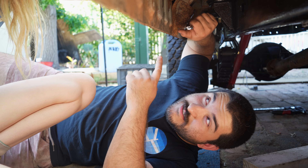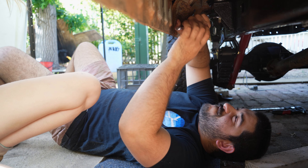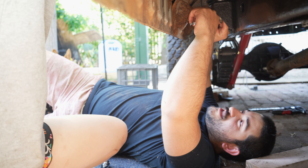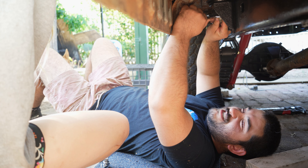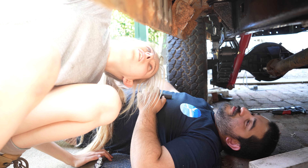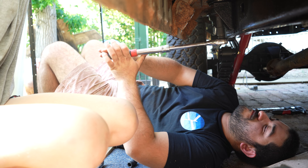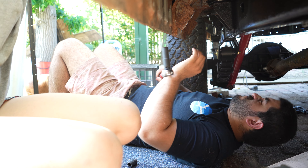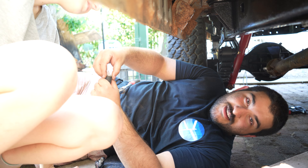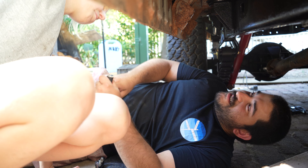When your ratchet eventually falls off the top, get some help. That's a super tight one — it's actually undoing the nut. What the hell is that angle — is this bolt bent? Looks like the bolt's been bent. Two snapped. The good news is they don't thread into the body or the chassis, so if they snap you just pull them out — unless they're bent.